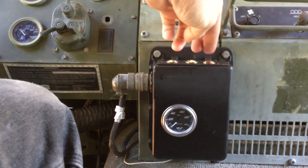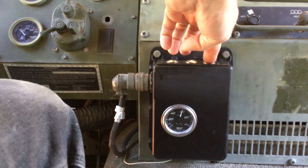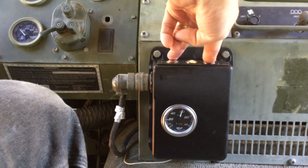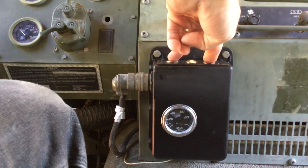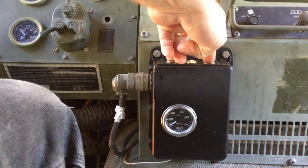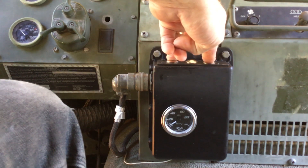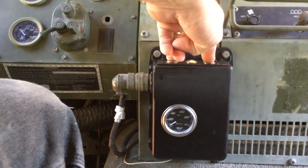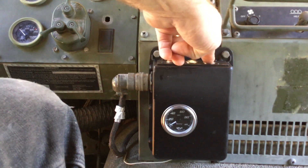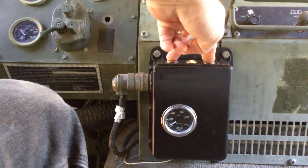To deflate the tires, press control, give a little shot of air to check the current tire pressure, and then press the deflate button. That hiss you heard is the air escaping out of the pressure relief valve on the pressure control unit. It drops down to about 6 or 8 PSI, and that opens the quick release valves and vents the tire pressure to the atmosphere.